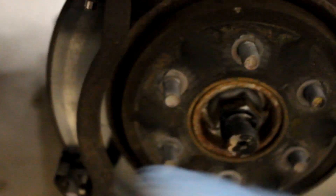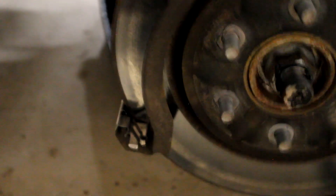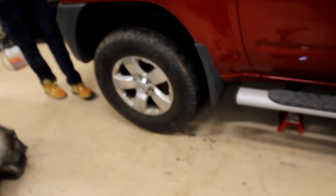The bracket snapped into place — I just had it in the wrong area. Both of these simply snap into place and then you can put your pads on. I'm not changing the rotor because it has plenty of life — it's nice and smooth, not miscolored, actually in really good shape. These pads came with the wear indicators already attached, which is a nice touch. Front brakes are done — they really needed to be done, they were in really rough shape. Techy G also finished the oil change, which was awesome.